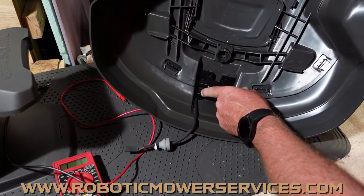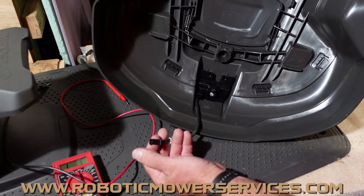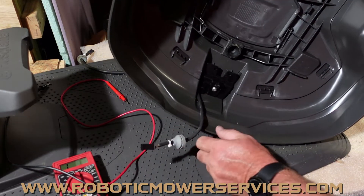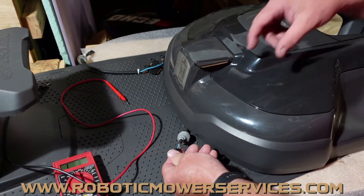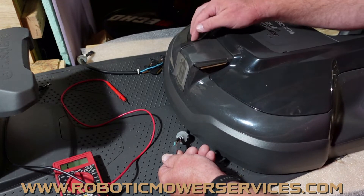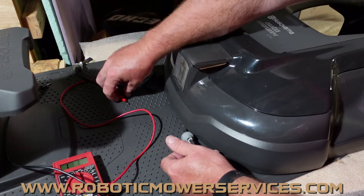You can see on this one where the brown wire is, but basically when you go to do a resistance test, you're going to know if you're on the right one or not — unless you have no resistance between either one of these and either of the contacts up above. Being that I know which side is which, it's easier for me. I know this is going to be the side with the brown wire, and this will be the side with the blue wire. We're going to show you how to do this continuity test.